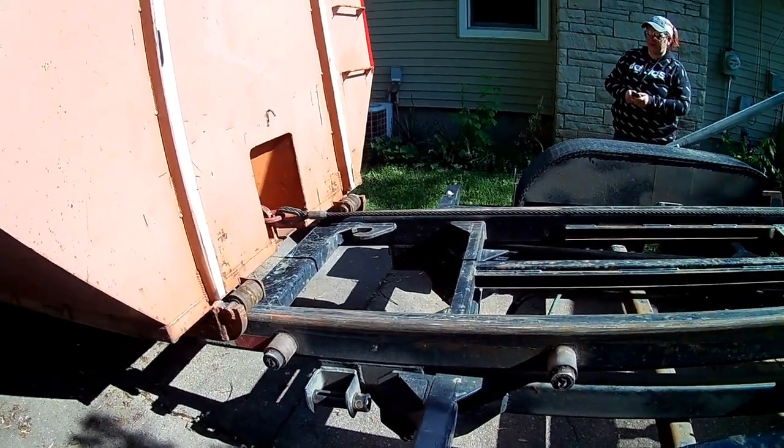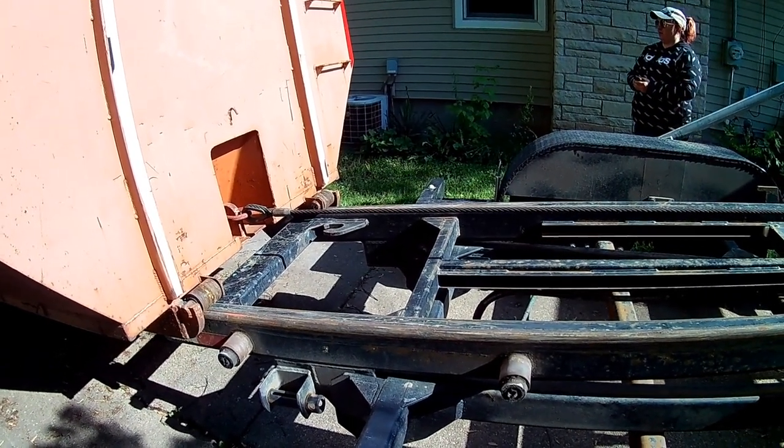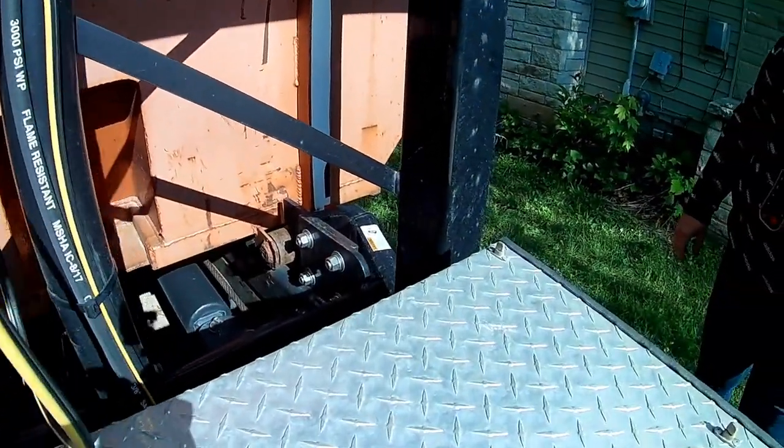Just the other thing, too, I forgot to tell you, always double check the door. Make sure it's good. The whole idea, when you pull it onto what we call the stinger, you get it on this bar, and if you're a little bit crooked, when you tilt that, it has no choice but to go on the rails. And you felt when you were pulling, it was grinding on one side of the rail because you're a little bit crooked. If it gets really bad, you're gonna have to pull forward or back up to get it lined up. But you're gonna run into it all the time. That's a little trick I learned that's gotten me out of having to back up or pull forward. I don't think you were that crooked on this one, but you never know. It could save you 5 minutes in frustration.